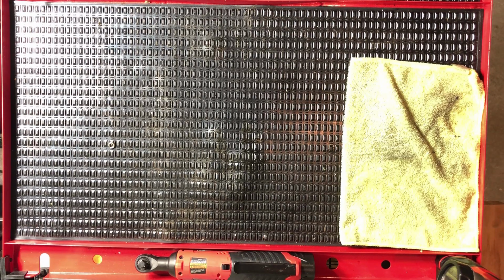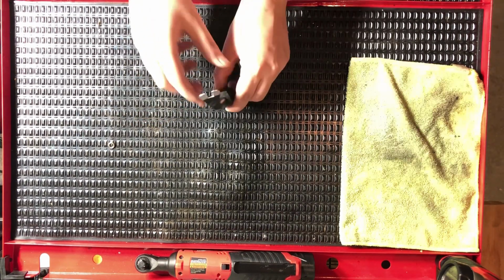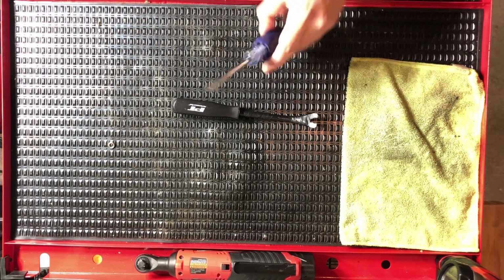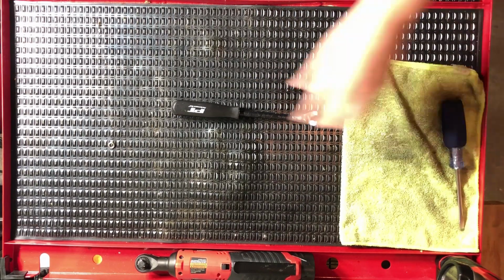I'm going to do a quick video on how to replace your C5 Corvette window regulator and motor system. Now this is a simple and pretty straightforward job. A couple different things that you're going to need to pull it off. First thing is a door pry. I wrap mine in electrical tape, and that's just to prevent any marring. You can use a flathead if you need to. A flathead will work, but you just have to be careful not to screw anything up.